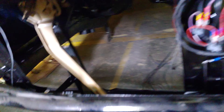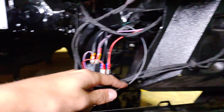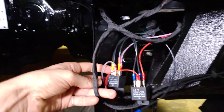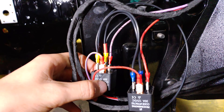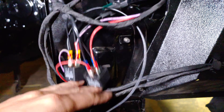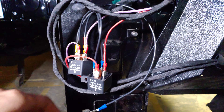Let me quickly recap everything I've been doing behind the scenes. First things first — I realized I never showed you in the previous video how the relays ended up being wired in. Even though I showed it on paper, I didn't show the end product. So here you can see they're wired in: it comes from the bulkhead disconnect into the relay, out of the relay into the headlights, and this is going to be ground. I'm using common ground, so you can wire two into a single terminal and then jump it from that terminal over to the next one — that saves wire complexity and keeps it nice and simple.